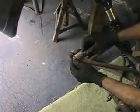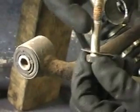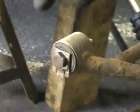However, what I experienced was something a bit different. When I had my bushing in there, I took the nut off and the bolt wouldn't push out. The reason it wouldn't push out was because, if you look at the bushing, there is an inner collar — a metal tube, probably steel — and basically it had corroded, or welded itself, onto my bolt. So when I wanted to push the bolt out, no matter what I did, hit it, whatever, it wouldn't come out.